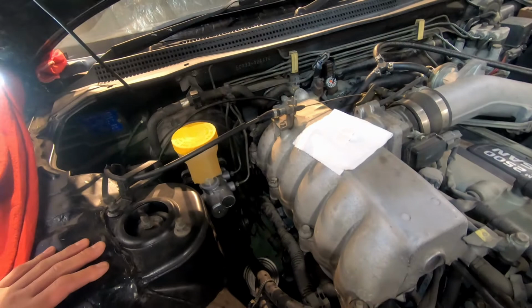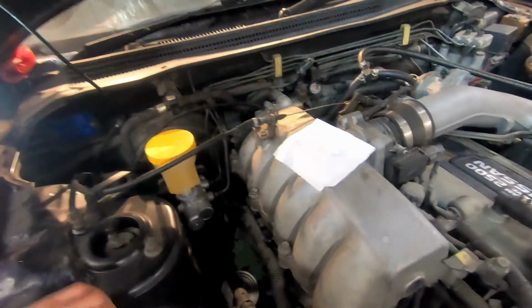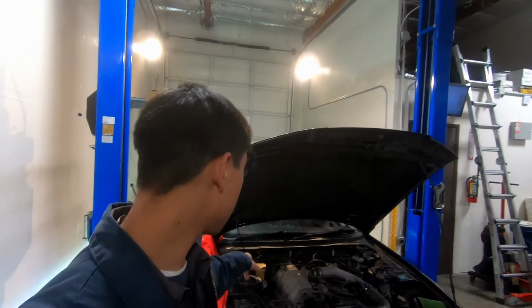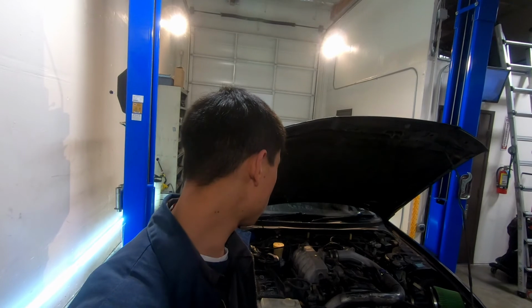I'm going to drive this car and still have brakes. So after you road test, I would do the tissue paper test one more time, verify that these are not leaking. From here you should actually bleed the brake system as you normally would. Open up the bleeder valves and bleed the brakes. And yeah, a solid brake pedal is definitely one of my favorite things in life. I hope I helped you get there.